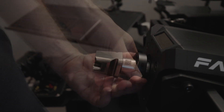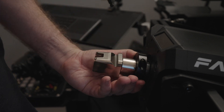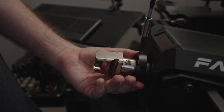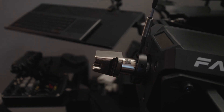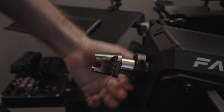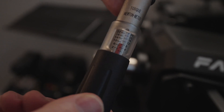I'm using a torque wrench here. No torque wrench is included in the box, and a lot of people claim you don't need one — I disagree with that. You need 10 newton meters of torque here, that's what it calls for. When I was turning what I felt like should have been 10 newton meters, it was actually something on the order of 5 or 6. Maybe some people can do this by feel — I definitely can't. I think you need a torque wrench. I'm using one made for a bike; they're pretty common. On the wheel side you have to go down to 1 newton meter, so I had to use a different torque wrench meant for those lower levels. For the base side you need something that covers 10 in its workable range. Here I'm showing the bike wrench dialed in right around 10.